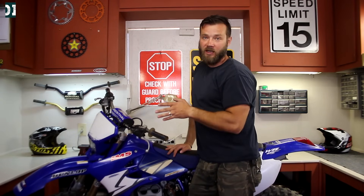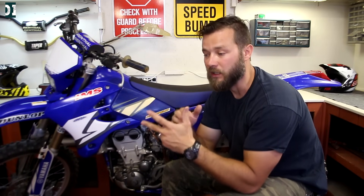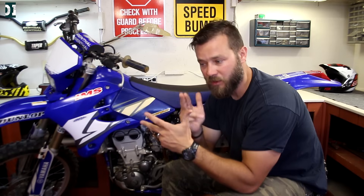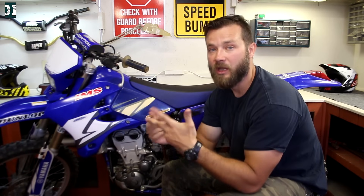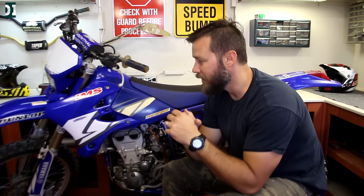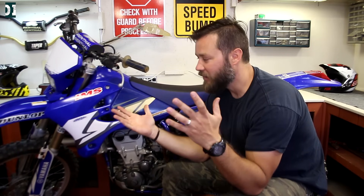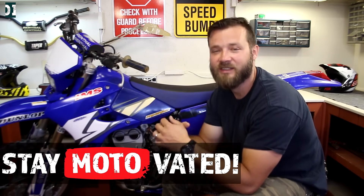Hopefully that helps. These three things will tell you if your bike is jetted correctly: smooth transition from idle to high RPM, no backfires when you come off the gas, and the hot start makes the RPM go up. If these three things work for you, your bike is jetted correctly, idle is adjusted correctly, and the fuel screw is adjusted correctly — just go ahead and have some fun on your bike. That's about it for today, and don't forget — whatever you do, stay motivated. See you later.